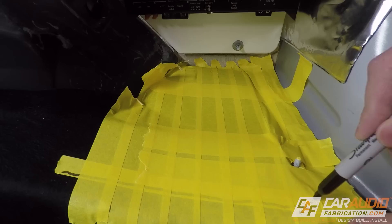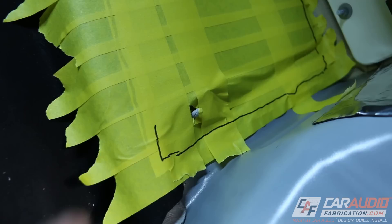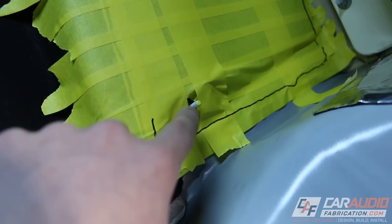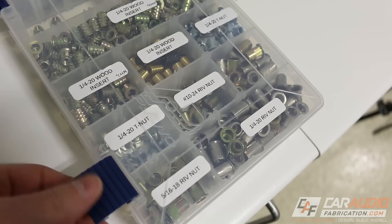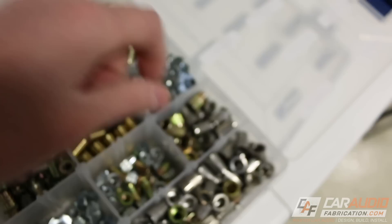I made several strips of tape across here. The vertical strips are just to hold everything together when I pull this out to capture that shape. I also made sure I captured this little threaded stud inside the perimeter — that allows me to drill a hole in my workpiece and mount it by applying a nut on top. If you didn't have a threaded stud, you could use a rivet nut: you drill a hole in the metal and use a special tool to rivet it into place, and it has threads to hold whatever you're installing.